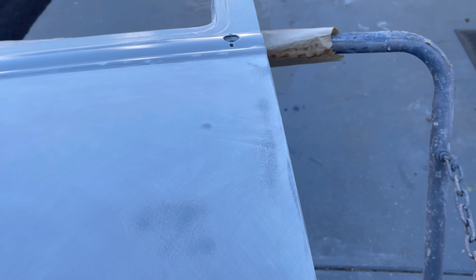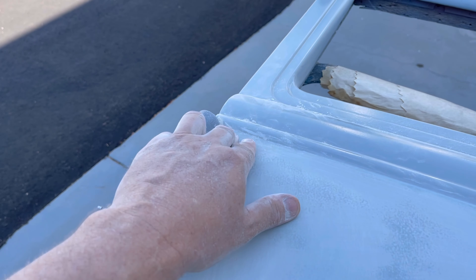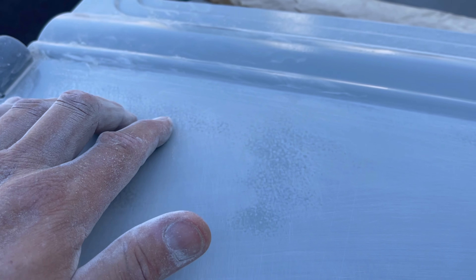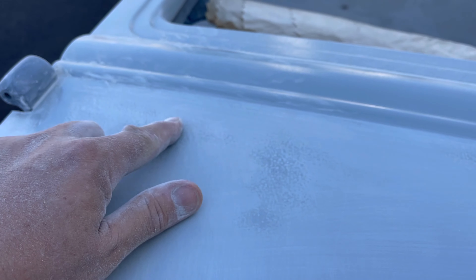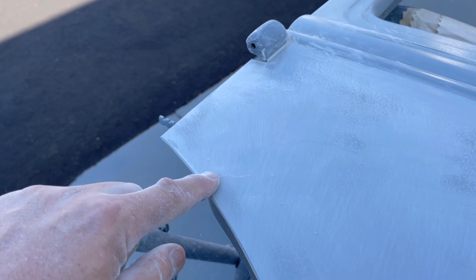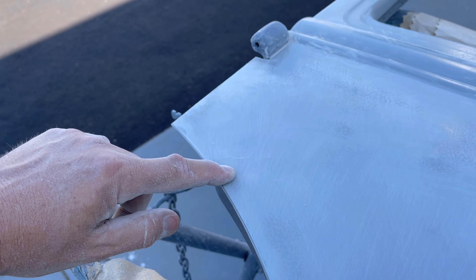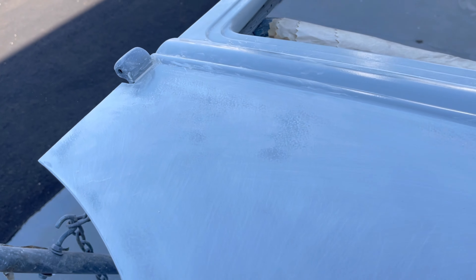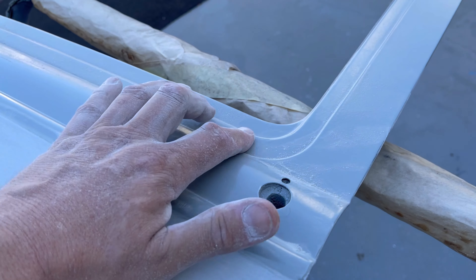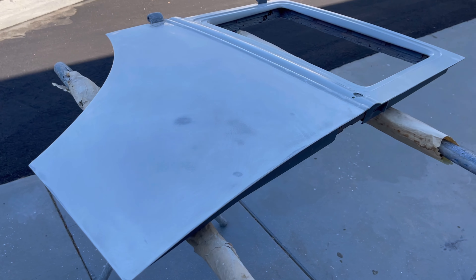You can't just gouge in there — you've got to work your way, sneak up on those areas. Over here I haven't hit this yet, but we're good up here. This will get worked out. You can still see the pock marks of the primer, but I hit metal right here. I'm low here because I have metal — so there's a little low spot there and a little low spot there. This is the stuff you get when you block. Up here you can see some drips from the primer — this will all get sanded out. Overall I'm very happy with how things are coming out.